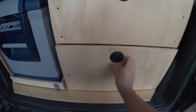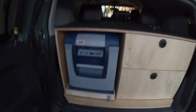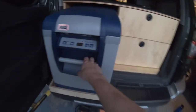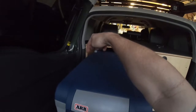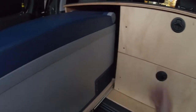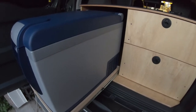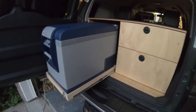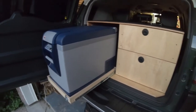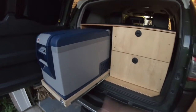That's the update I have for you guys. The mat stuck on there pretty well — we'll see how long it lasts. The ARB refrigerator basically slides right out. I've left a little more room on one side for ventilation, and there's ventilation on the other side too with a hole in the back for extra air. I may put a fan back there eventually because in the middle of summer I'm not sure it's getting enough cool air. If I have a problem with the refrigerator not cooling I may cut a hole and draw in some fresh air — but it's not sealed so it should get some air. Just something to think about if you do something similar.